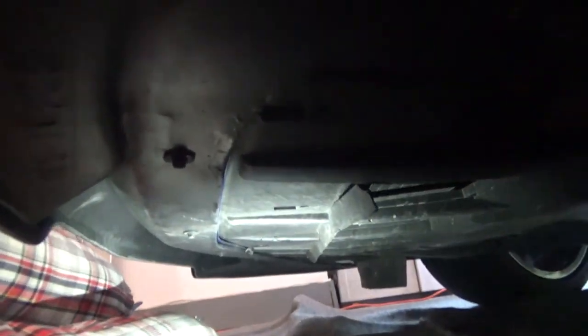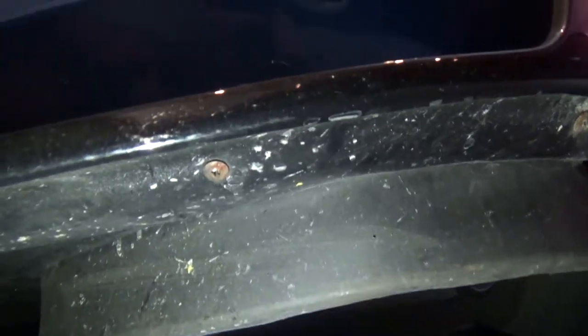And now that the side bolts are off, from the top bolts I'm going to go up to the bottom of the car. And as you can see these bolts right here go along the center. Just want to detach these ones right here. But do not remove the self-tapping screws that you have for your splitter if you do have one, because you need those to stay in your bumper. And besides the one up front you want to remove this one and also one on the other side in the center.